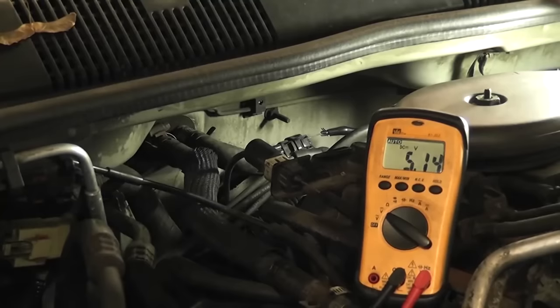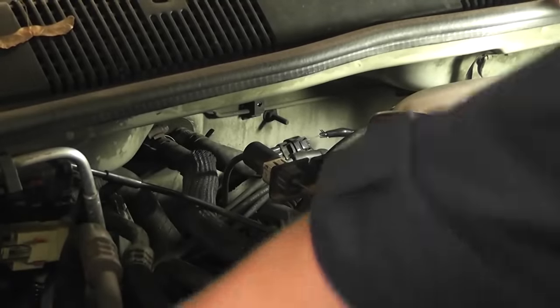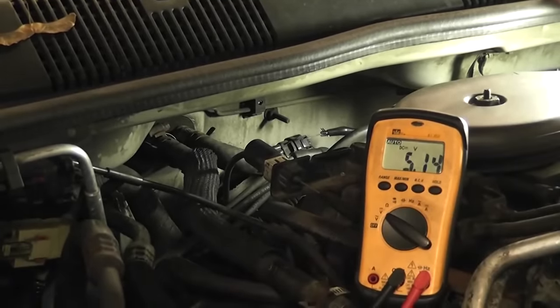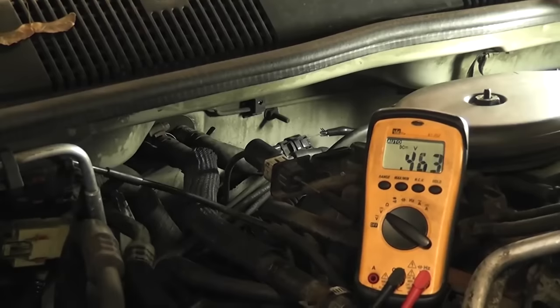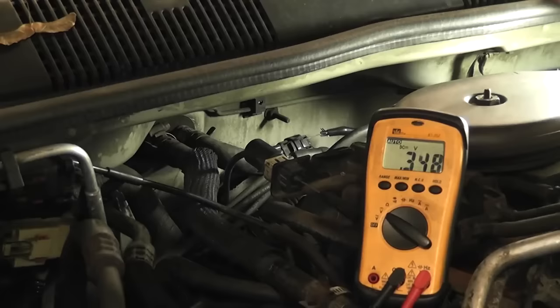There it is right there — it was just about getting that window for that hall effect in the right position so you could see that high-low scale. So what's the maximum number this hall effect is producing? It's five volts. The minimum number you saw was like 0.04. There's your high-low signal — this is what you would do with a voltmeter. With the engine running, it's going to be the same thing — you're not going to see the high-low signal. The engine running signal shows a zero to five volt square wave average of 350 millivolts. That's pretty tough to do with a voltmeter.